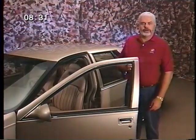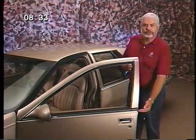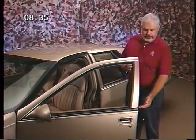In my opinion, a dealership technician should only attempt a hinge adjustment as a last resort. When even an experienced technician loosens the door hinges, he runs a risk of creating wind noise, a water leak, or poor fit, or any combination of the three. Once a door striker is secured and we're assured the flushness from this feature line down, then we look at the belt line area up to the top of the header.